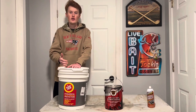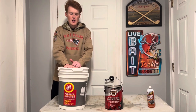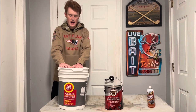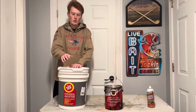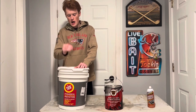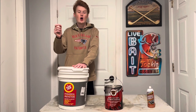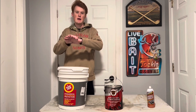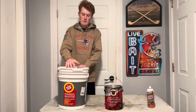Fluid film is a lot thinner compared to wool wax — we'll get into that in a minute. Yes, it is thinner and you probably shouldn't go through an undercarriage wash every day in wintertime, but the trade-off is the creeping ability of this product. When I spray this on the frame, if a tiny little piece of it washes off or I missed a spot, the fluid film is actually going to seep into that spot and protect the frame even more. That's one of my favorite parts about this product. My other favorite part is the price.